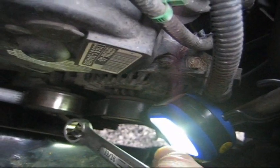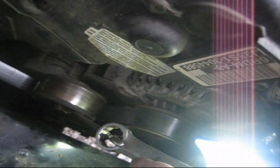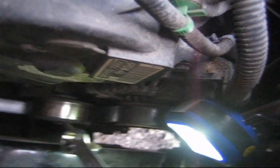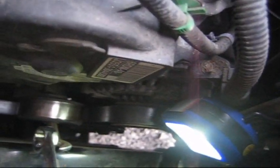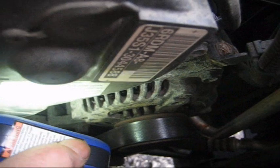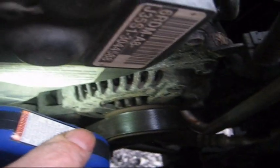Just showing you what we have over here. They have a tool to do this, which I don't have on hand. So I'm using a 14mm wrench on the bolt that's holding that pulley on, and using another wrench against it for leverage to pull it back. You see that moving? That gives me enough leverage to get that belt out. Usually there'll be some kind of slot or something where you can stick a pin in to hold it back, because that pulley's going to have to be held back again to get to that nut that's holding the alternator in.